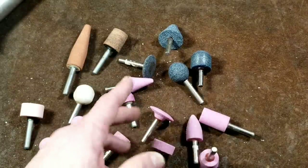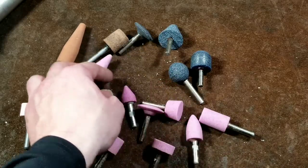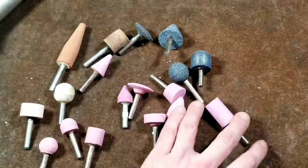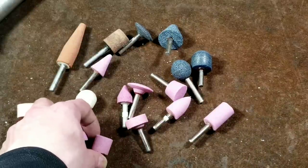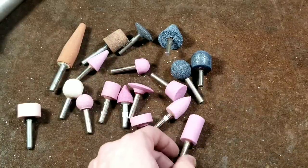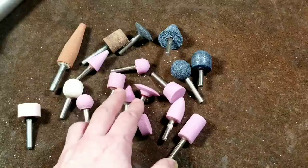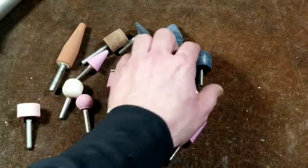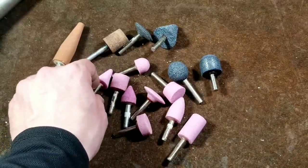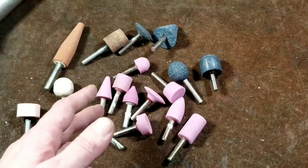I was sorting through my grinding wheels and came across all these and decided to make a quick video on them. That was just a basic overview and introduction to die grinder wheels, making you aware of all the variety of styles. When you need to do some die grinding, you really need to figure out what you're grinding, whether you're on the outside or inside of a surface, and whether a standard cylindrical wheel will work or whether you need something more specially shaped. You will get much better results when you use a wheel whose shape is matched to the work. Anyway, I really appreciate everybody watching and subscribing — and if you haven't subscribed, please do. Caddis Maximus out.